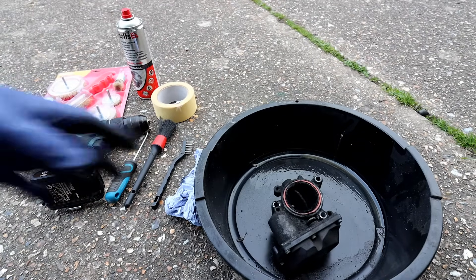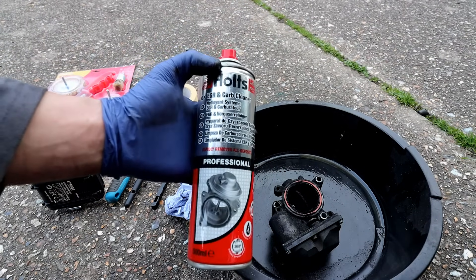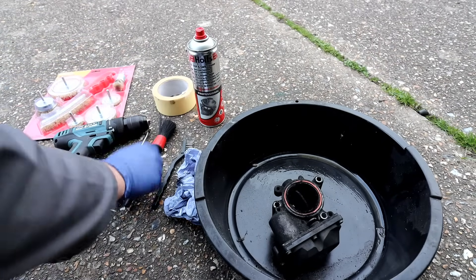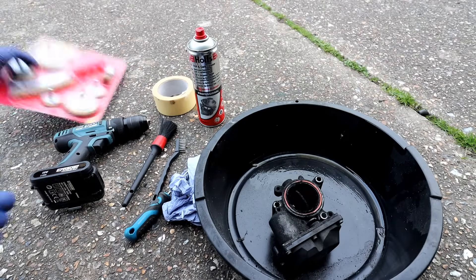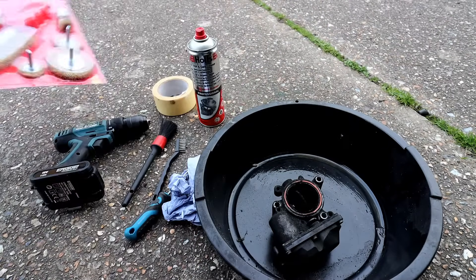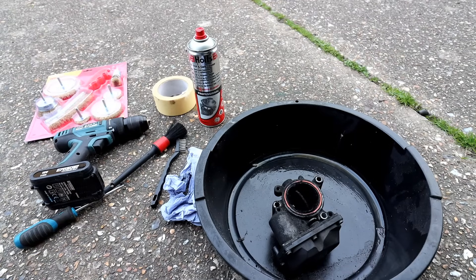What we're going to do — I'm glad this is the case — you should be able to just clean it up and fix it, and that's not going to cost you a lot of money. All you need is a spray — I definitely recommend an EGR and carb cleaner — this will get rid of the carbon. You can get tape just to tape up the contact so no rubbish gets in there, and a wire brush or flat blade screwdriver. Or you can get a kit like this — link in the description below. It's handy for everything else and really cheap, about a tenner. We're going to use a drill attachment from it to make it easier. Scrape the worst bit with the flat blade screwdriver first, then spray it and start cleaning.